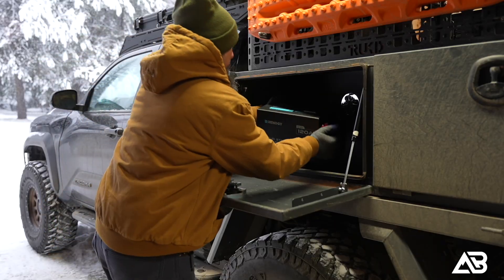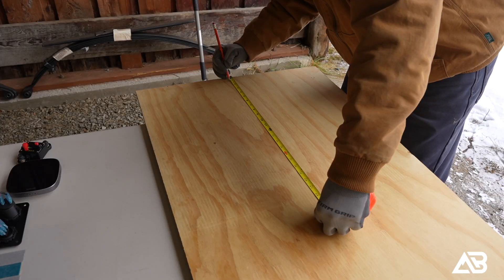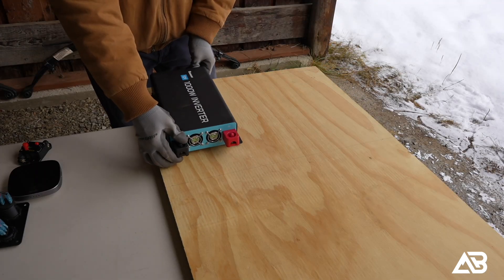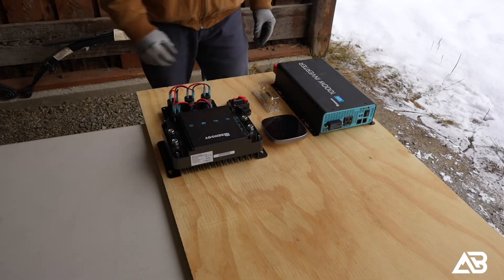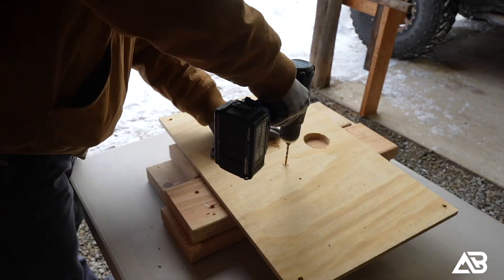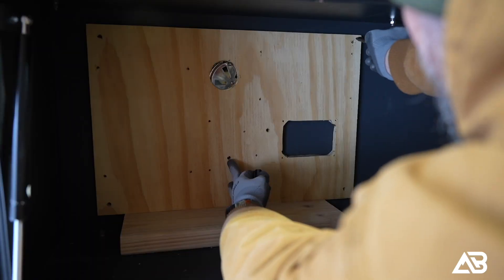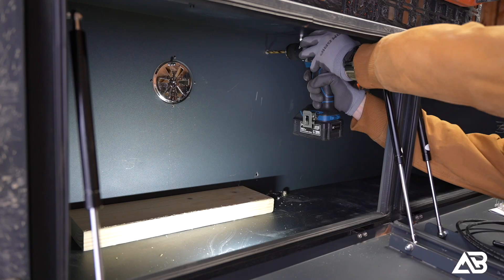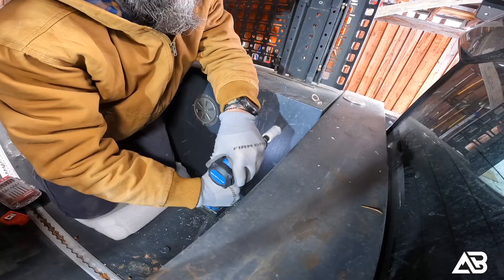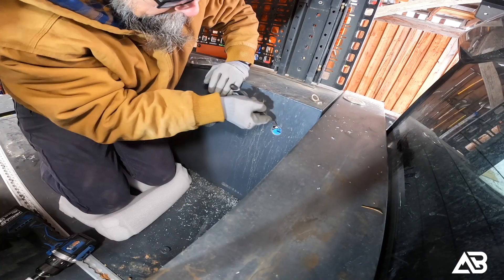With the wiring run, I test fit all the components inside the side box to determine the layout and spacing. I then cut a half-inch plywood mounting panel measuring 20 by 22 inches — that'll obviously change for your application, but for me this was the perfect size. Once the panel was cut, I gave everything a good test fit again, then marked and drilled mounting holes for each component, and marked and drilled all the holes in the aluminum side box from NextJump Outfitters. I also drilled a half-inch hole to feed the wire through the back of the flatbed, and another half-inch hole directly next to it to feed it into the side box.